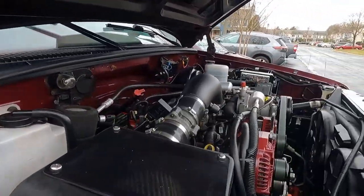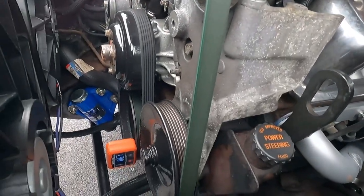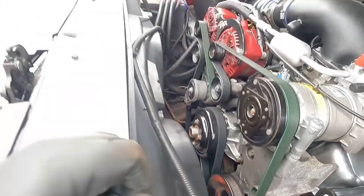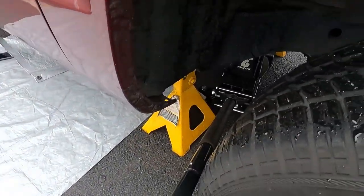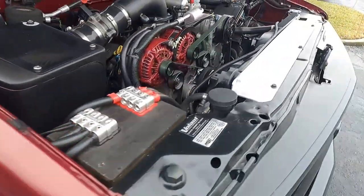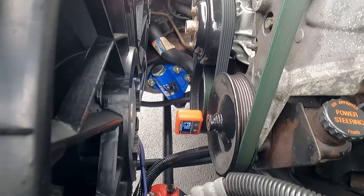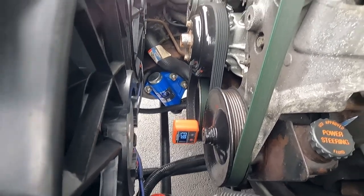And by the way, the reason why it looks the way that it does is because since it's sitting on its side, you'd take 90 and subtract this number from 90, and that would give you what you currently have. So I'm just going to come around, it's already in place, keep giving it a couple of pumps and come back and check to see where we are. Once I get it in the right place, we'll be good to go. So that just gave us 86.3. So we're getting closer, inch by inch. Well, not even inch. These are really slight movements.